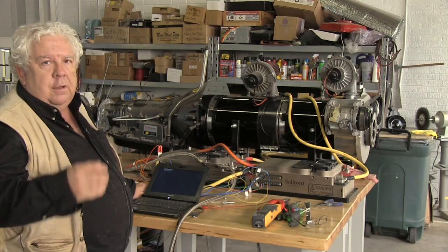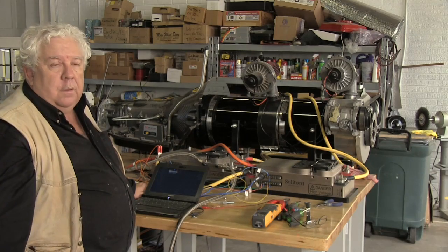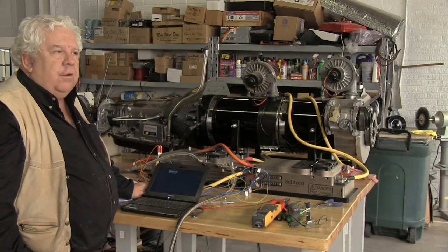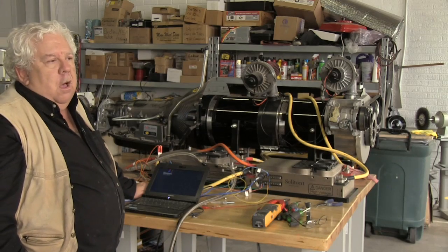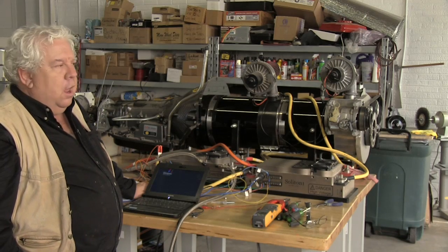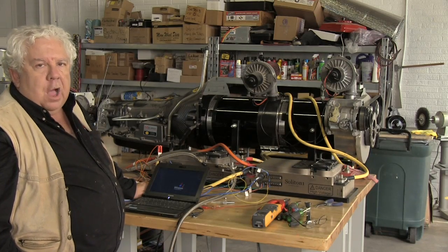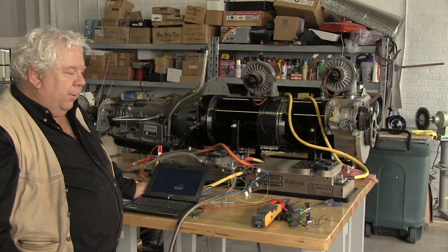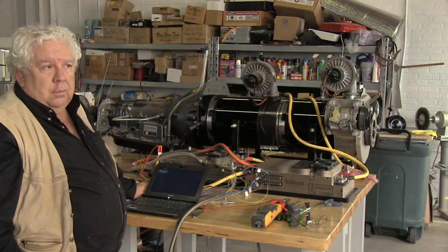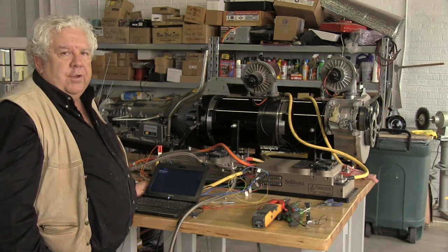It's not going to drive, and that's the ultimate dodo mode. Not a bad idea. And then a separate level, instead of 170 or 168, let's set it for 120 volts, since I know it's going to sag to 147 for when it's under load. And since the controller knows whether it's driving or not, and it's also monitoring the voltage, it was an easy thing in software to do to have two levels.